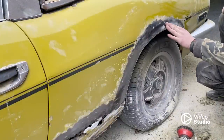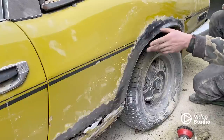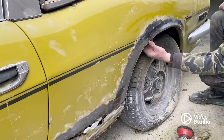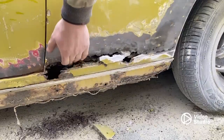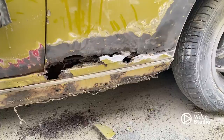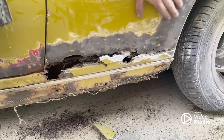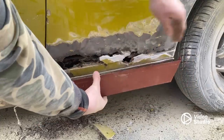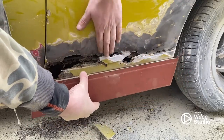With this rear panel I'm actually really impressed with how solid it is. Some of it's quite warped, especially down here, but there are no holes in it. I'm still going to change this for a new quarter panel because you do get rust between the two skins and I want to sort that out — I don't want it coming back in six months. Looking down here there's quite a lot of rust on the inner panels, but there is good metal higher up; it's not rotting all the way through. The new quarter panel is already in the boot and it should go over or under the sill with a bit of sheet metal work to joggle the edge in.